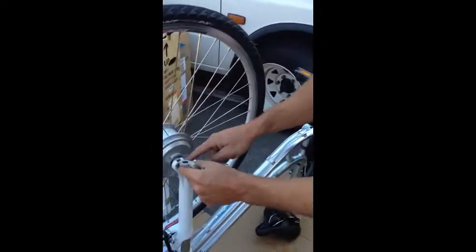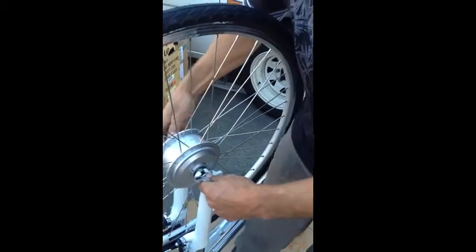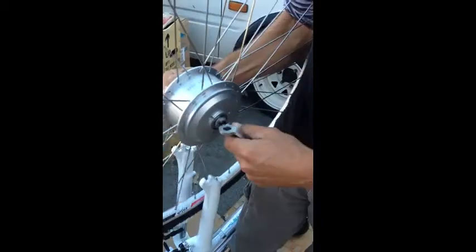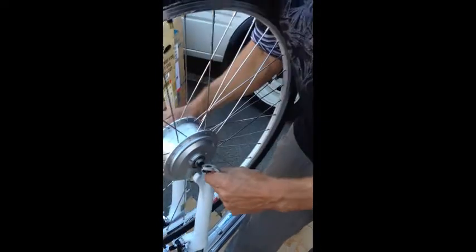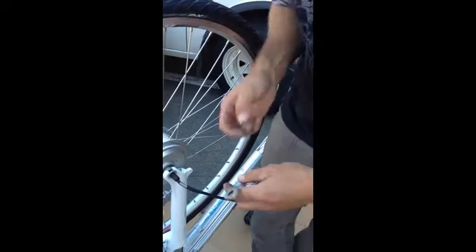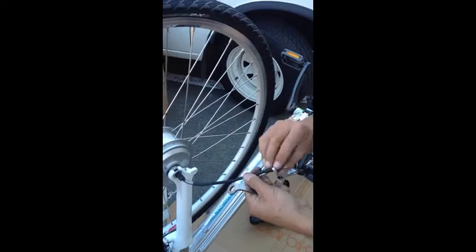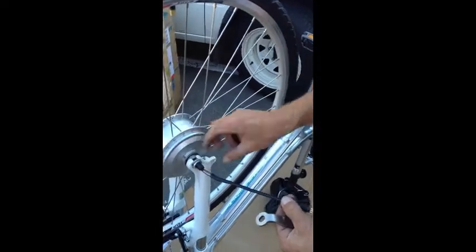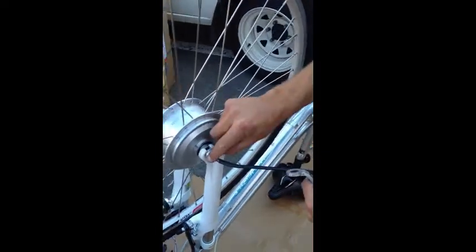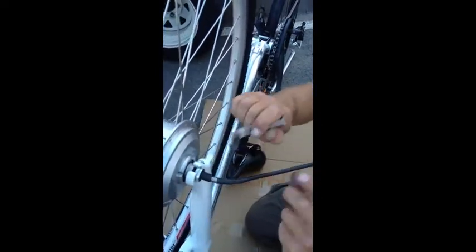You can see here the kit comes with one axle. When you put the wheel in, the axle has a washer with a lug — that one sits on the inside of the fork. Then you have these other ones to space it out; that one sits in the recess. With this fork, the fork is quite close, so I use the second washer just to space it out — it makes it fit better. It depends on the bicycle you put it on. Sometimes you don't have to bend it at all — you can just put one washer and it works well. But this one, because it is recessed, I do need to put the bend on.